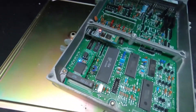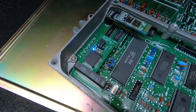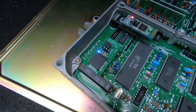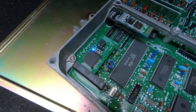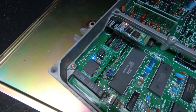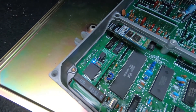You can also use the dual tune switch for a more aggressive tune, like a high boost versus low boost tune. Or if you have a separate tune for something like nitrous with a different activation, you can set that in tune slot two and have it activate at the flip of a switch.